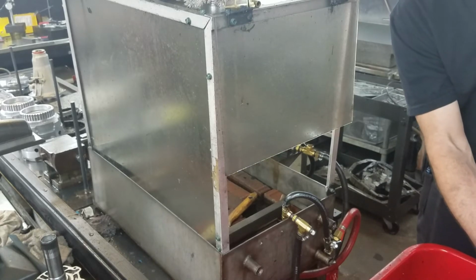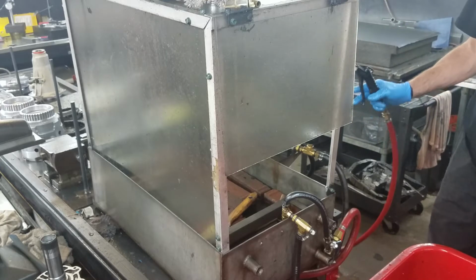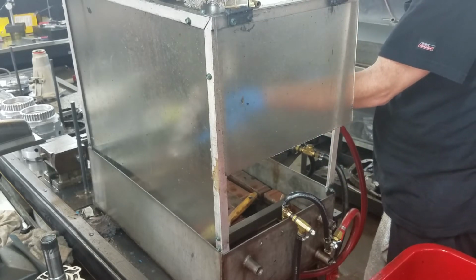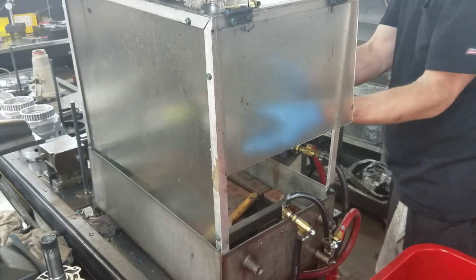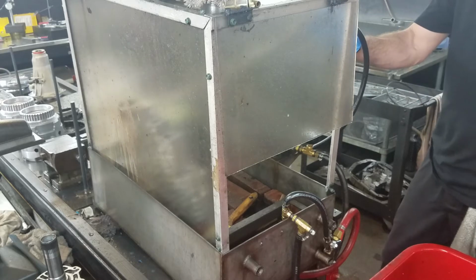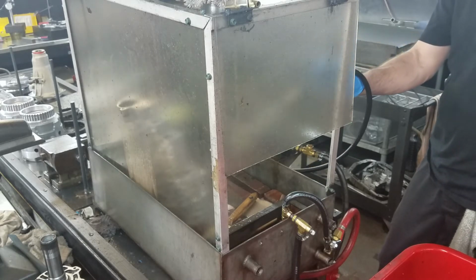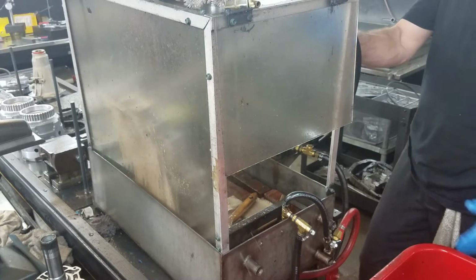And this is another good reason to do complete valve body teardowns, so you can get rid of the mess. You can make sure there's no chips in these things. This valve body is completely empty except for the forward abuse valve. The only thing I did is completely disassemble this valve body, and not do anything else to it before I turned the camera on.